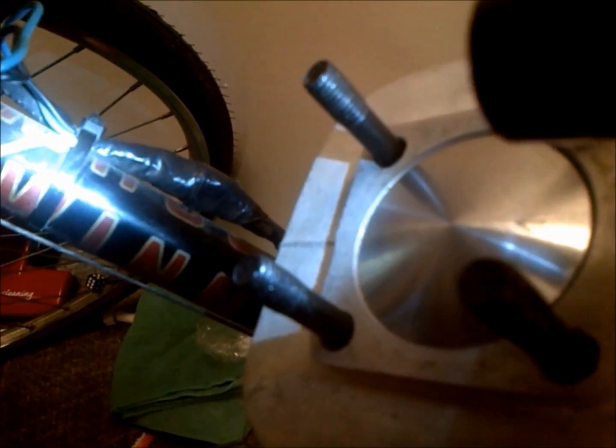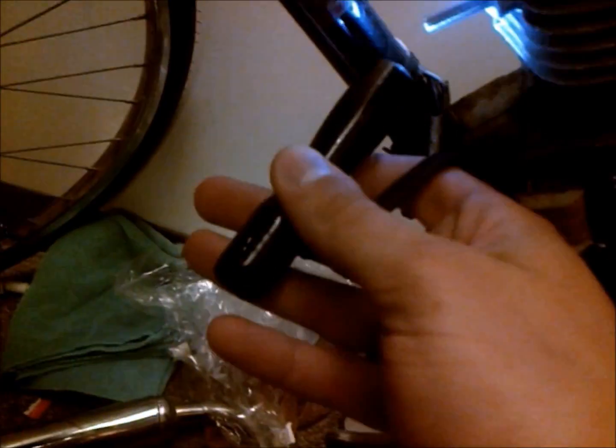Anyway, what I noticed when I was mock fitting this all together is that at top dead center, which we're at right now on the engine, you can see in there a solid 1/5 of the intake port is blocked off by the piston. And I know that I have it correct because your little arrow here needs to point towards the front of your engine, or if you have your engine in some funny orientation, this arrow needs to point at your exhaust port, which is this side over here.